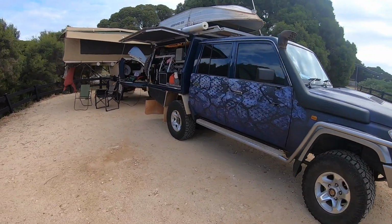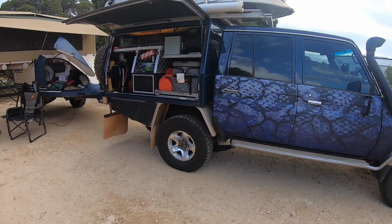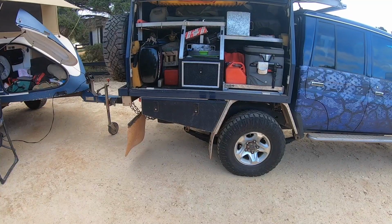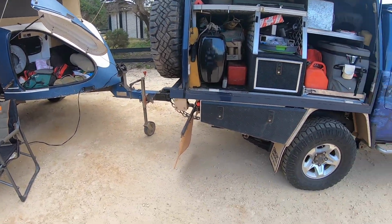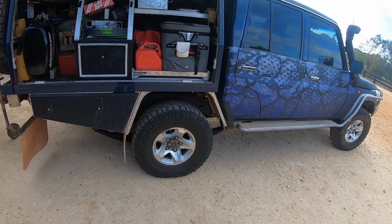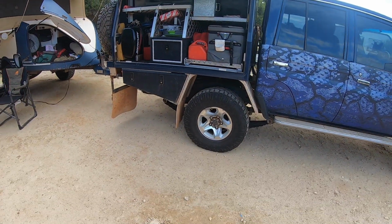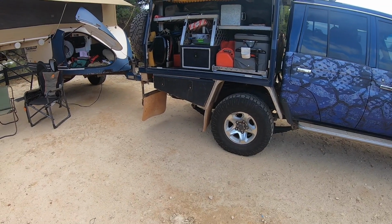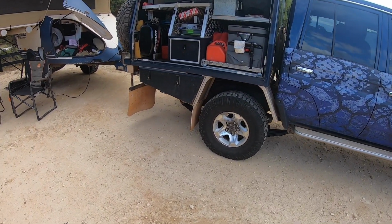So the symptoms, most noticeable when we were over at Defective Island a little bit over a month ago. What was occurring, and we weren't travelling that fast and we were towing the camper, is that in the cab we could hear a clicking or clunking sound, as if the shackle bushes were worn and they were banging the crap out of themselves. That was my initial thoughts.